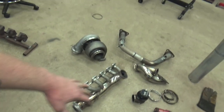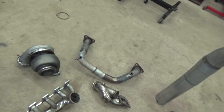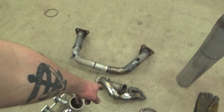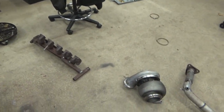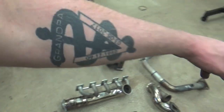Alright guys, we got all the turbo pieces out — they're all laying right here. All the exhaust side stuff: crossover pipe, manifold, up pipe, down pipe, turbo. The only thing we don't have out is the driver's side exhaust manifold because that's just a stock Gibson Shorty exhaust manifold — it's already ceramic coated so we don't need to paint that. The other three pieces we are going to ceramic coat. That one we're going to leave alone because it's stainless and it looks really pretty. We also got that O2 sensor fitting welded in. We're going to leave the exhaust housing and not paint that, but everything else we are going to paint.